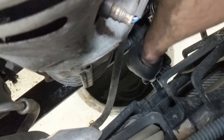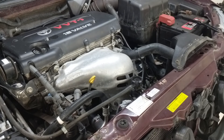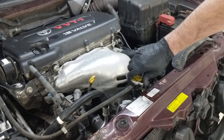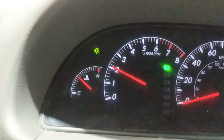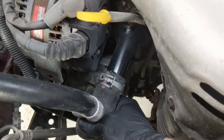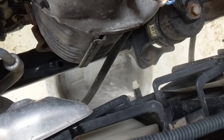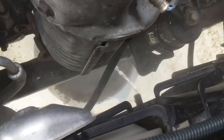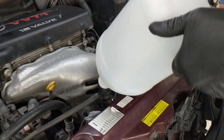I'll repeat this process a few times adding clean demineralized hot water. These next couple of rinse cycles I'm just going to do in the shop so I don't have to go on a drive again. It takes a little bit longer, but I start it up, get it hot with exhaust vented, rev it up just a little, and run it until it reaches operating temperature. I can feel the left-hand hose — it should be hot with a little pressure because the water pump is circulating and the thermostat has opened, so the water in the radiator is mixing with the water in the engine.